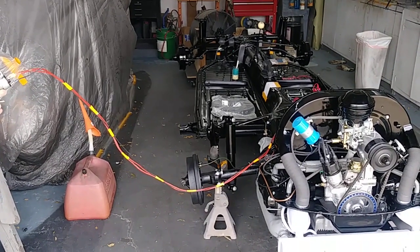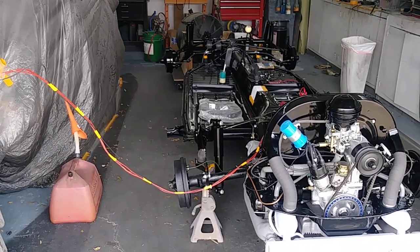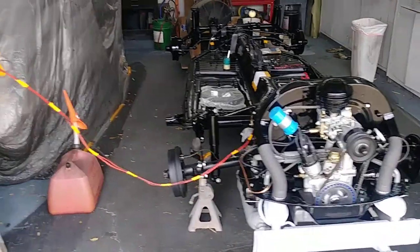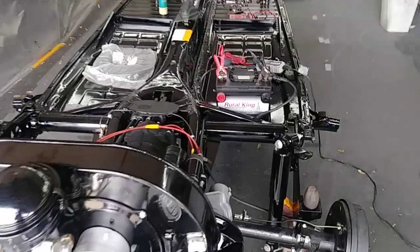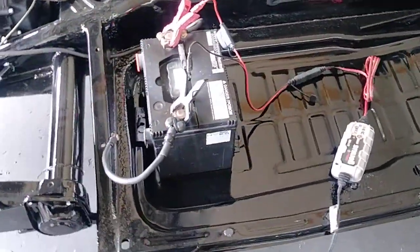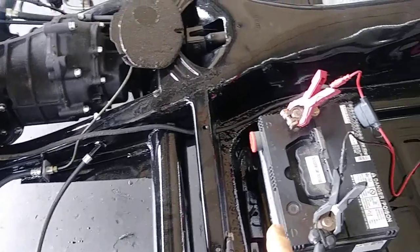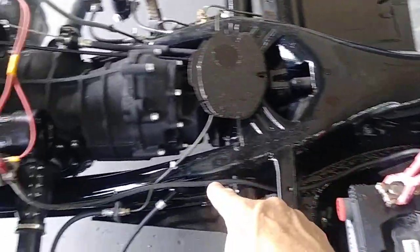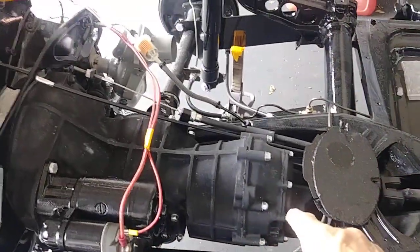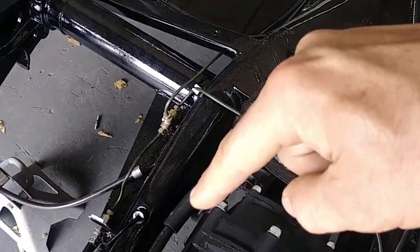Here's the video, at request of a few people, about how to make a wiring harness to start a motor on a bare chassis. What you're gonna need is first a battery — I happen to have mine hooked up to a trickle charger so that it keeps charged. The battery is hooked up to the chassis for a ground, and the positive runs to the proper terminal on the starter. The transmission also has a ground wire here so that it gets good ground.